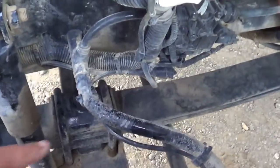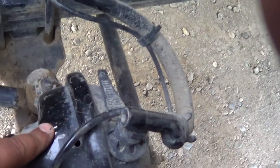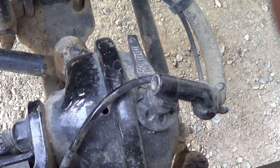Now I'm going to inspect my air brake hose. I'm going to make sure there are no abrasions, bulges, cuts, or leaks, and it's securely mounted, no missing hardware. Right here is my brake chamber and my brake chamber clamp. They're not cracked or broken, securely mounted, no missing hardware, and they're not leaking.